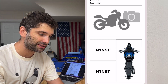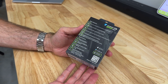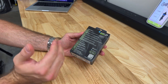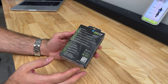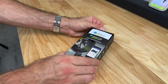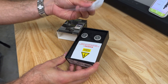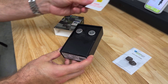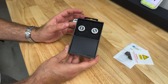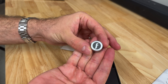The rear tire is set to 42 PSI, and again it gives you a min/max range — the max is higher because the tire warms up and pressure builds, so you don't want alerts all the time. You save that and click next. You can put in your vehicle make and model, but I don't need to do that since I'm registering one bike. On screen you can see it shows the Honda with the front sensor and the rear sensor. Now let's unbox it and get these sensors set up. The system is waterproof so you can ride in the rain without worrying, has up to one year of battery life, and you can change the battery yourself. The sensors are very lightweight at 7.6 grams so they shouldn't affect the balance of your tires.